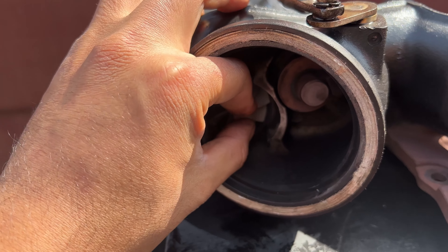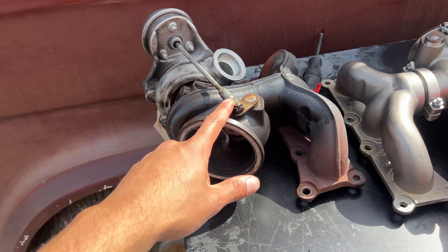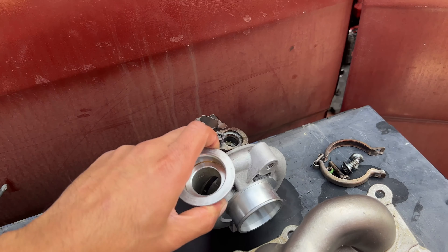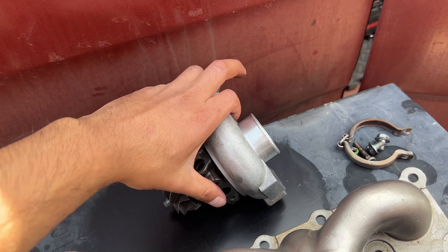There's no play in this new one whatsoever. The rear turbo was still good — no wastegate rattle, still solid at 30,000 miles. It was the front one that was leaking. It was dripping down through the front of this gray case, spinning up into the charge pipe area and dripping from right here — basically the whole gray part was wet.